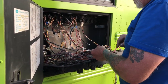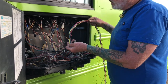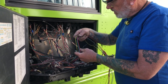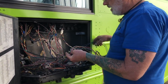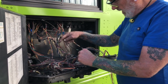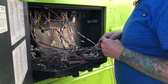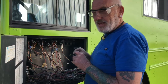Back here's where I unplugged the ones I didn't need. Once I separated them out I just followed them back here and unplugged them from the panels. So this is left turn, that's one turn, that's the other turn, brake lights, marker lights, and backup lights. We've got to get those all inside the bus to our little box. I'm going to tape them and feed them through there, and where I feed them through I'll put some wire loom on it. They're all going to end up going just like that.